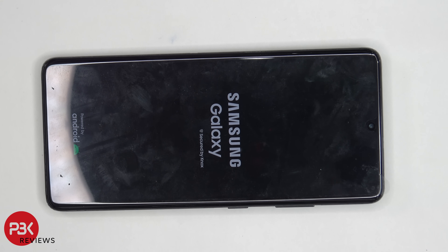For repairability, I give this phone a 6 out of 10. The battery itself was extremely difficult to pry off and it's not going to be an easy replacement. The screen cable is affixed to the screen and not detachable like the S21 — that's another downside. Also, the back plate is glass, so it's a bit more difficult to pry off compared to a plastic back plate. I hope you guys enjoyed the video — make sure you subscribe and click on that notification bell so you'll be notified the next time I upload. Thanks again for watching, and I'll see you guys next time.